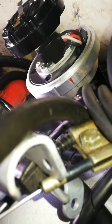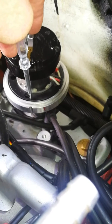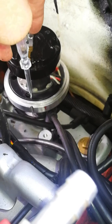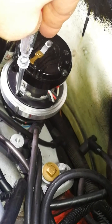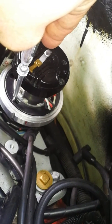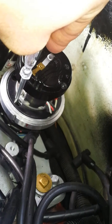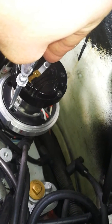That way it's turned a little further and hopefully it's phased better. Right now the falling edge is at that position and the rotor is at 50 before top dead center. Now at 30 before top dead center the rotor is at this position, which I'll slide underneath what was the number eight terminal, which I'm gonna use as the number one terminal now.